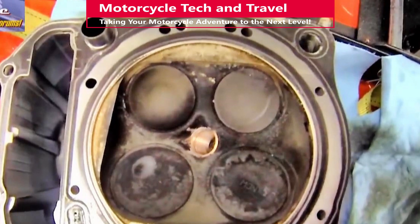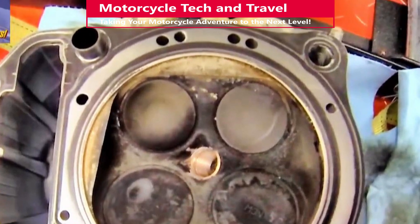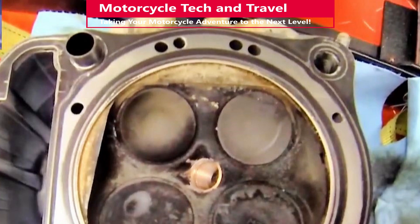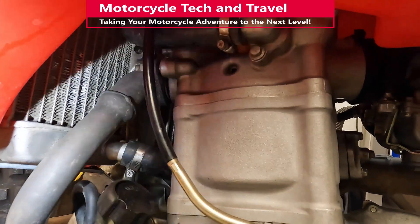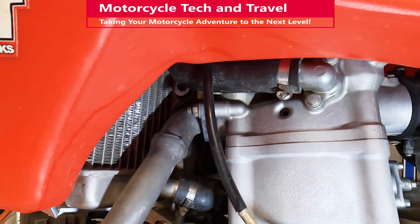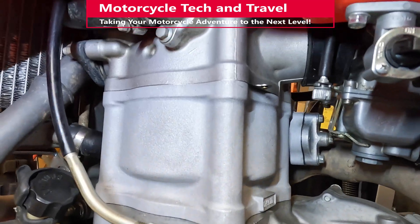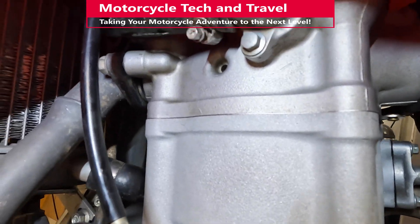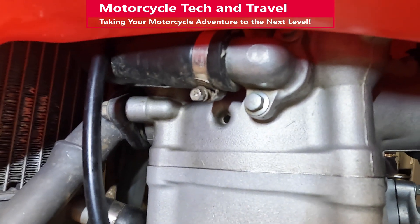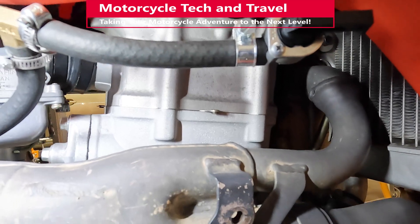Excessive engine overheating with an aluminum cylinder head can also cause cracking around the exhaust valve seat — a common source of cylinder head cracking into a cooling jacket in liquid-cooled aluminum head engines. Severe overheating can also warp a cylinder head or cylinder deck, causing the head gasket to seep. Test the engine's cylinder and cylinder head temperatures with the infrared laser thermometer gun. Check the cylinder jacket for uniform temperatures — temperatures are hottest near the top and combustion chamber. Check the water pump area temperature.